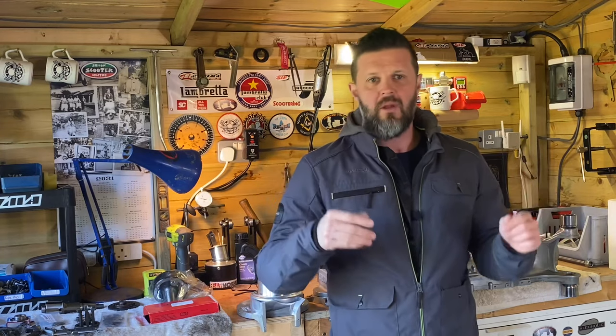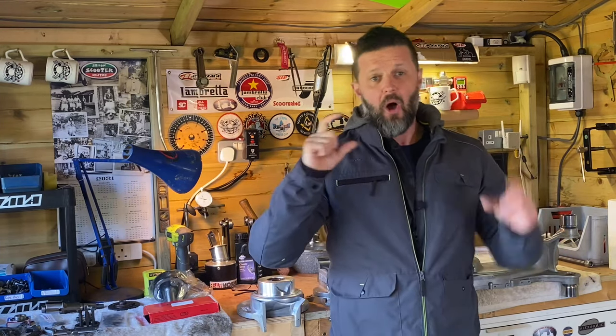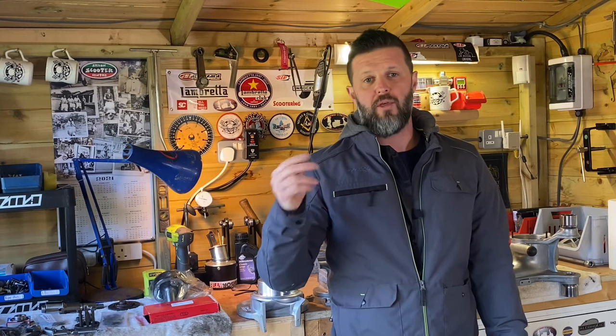I've upped the pilot jet from a 50 on the Clubman to a 55 on the expansion. I've still got the AV266 atomizer, which is quite a big atomizer for that size of engine. Obviously it's a 275, but they're individually smaller, 137 or thereabouts cc pots. So they're quite small to carry an AV266. So that's nice and healthy through the mid-range. I've got the X7 needle on the second clip. My mixture screws, 1 3/4 turns out. Running the 300 float valves, and I upped it from a 128 main to a 132.